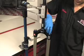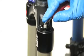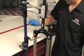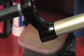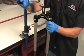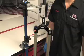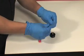At this point, you should already have the lowers removed from your fork. Verify that all air pressure is removed from the air chamber before proceeding. Unthread and remove the air spring top cap with a 24 mm socket wrench. Remove the fork from the stand and pour any air seal lubricant into an oil pan and replace the fork in the stand. At this point, remove and inspect the Schrader valve. Lubricate it or replace it as necessary.